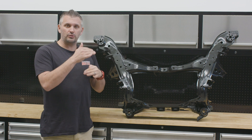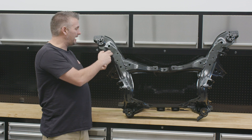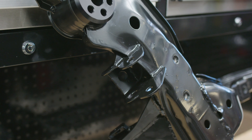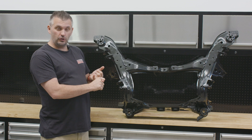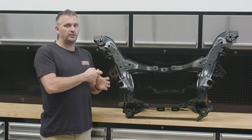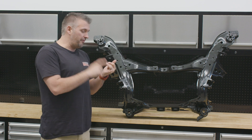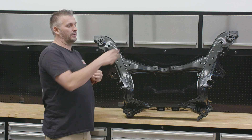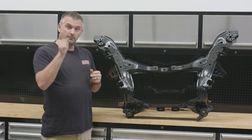You can use shims to adjust the squat or anti-squat, but because we've dialed more squat into the car by modifying our front lower pickup point, we're not going to mess with those shims — we're going to use all the roll center adjustment possible. So all up, our modified rear subframe is stronger, looks new, has solid bushes, we get roll center correction, and we get more squat by getting rid of the anti-squat in the lower control arm. This is something you should do to every R chassis and every S chassis rear subframe — it's been done to Jet 200, done to our GTR, and essentially we do this to all R and S chassis cars, and you should too.